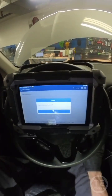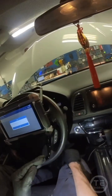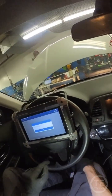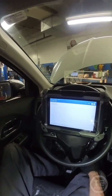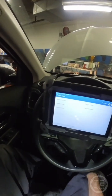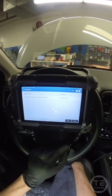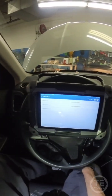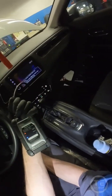Check for DTCs. Ignition off. I like that you can select OK and it doesn't have to wait to register itself that you have cycled the ignition — that's very nice. Let's check for codes. We got no codes. That's it, we're done. Complete seat weight sensor initialization.